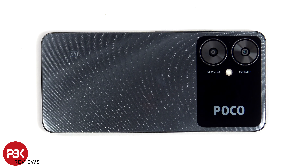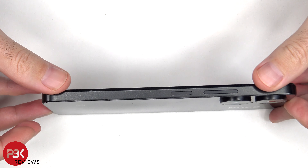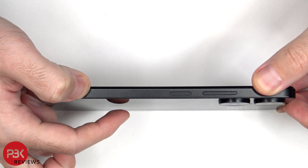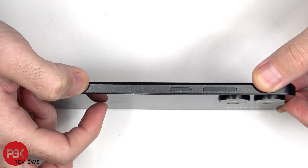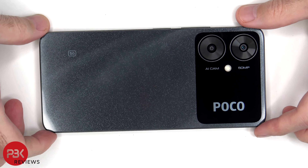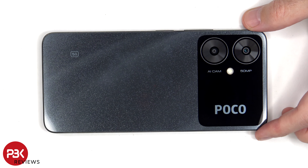Heat needs to be applied to the back plate with either a hairdryer or a heat gun to loosen up the adhesive underneath, and then a pry tool can be used to pry the back plate off. One thing I noticed while heating up the phone: this plastic back plate seems to be very thin, so once heated up the back rises and forms a bubble, but once it cools down it sits back down. This might be something you'll encounter while using the phone when it heats up — the heat might cause the back plate to rise up a little bit. It's more of an aesthetic thing and nothing to really worry about.